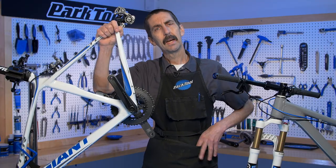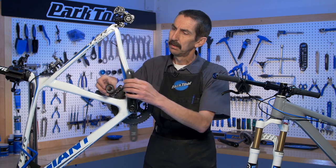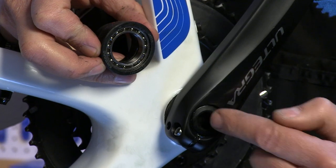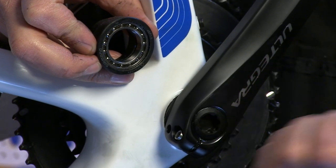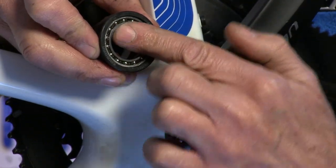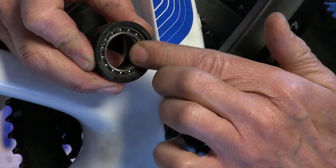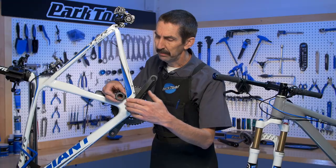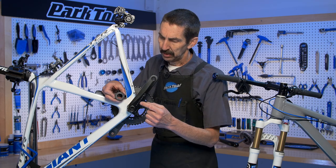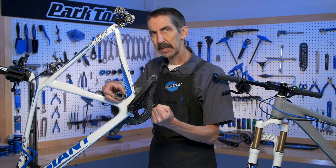The bearings inside prefer option A. In option B, the cap was over-tightened, pushing the arm into the bearing. The inner race should turn free and easy, but when you over-tighten the arm it mashes into that bearing and binds it. This is only a light adjustment to bring the arm over to the bearing, but not crush the bearings.